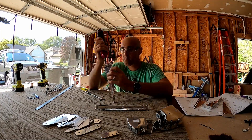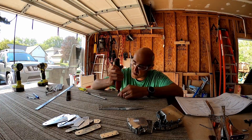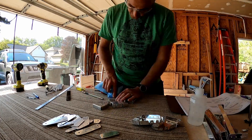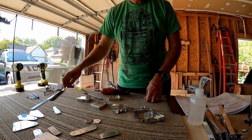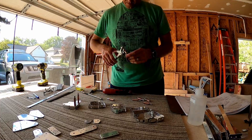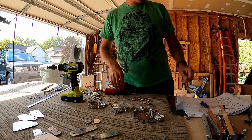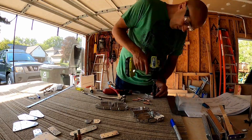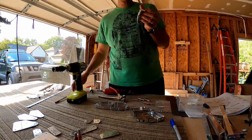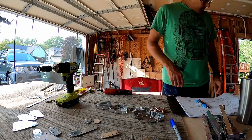I decided it was time to take a look at it. I did assemble them both on the table facing each other in a mirrored fashion, similar to how I did the flaps. But I still second-guessed myself several times on the attach brackets because I wanted to make sure I got them right. The aluminum is probably about 3/32 of an inch thick, and I didn't want to cut and match-drill new ones, nor wait for a new order from Van's for those parts. So I was trying to be careful to get the right part set up correctly for both the right and left ailerons.